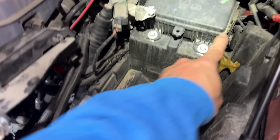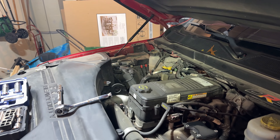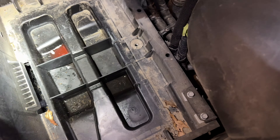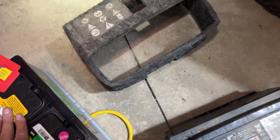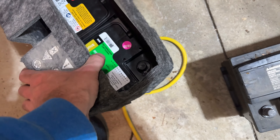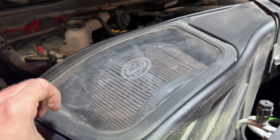It's designed to keep the battery from moving around while you're driving. I'm going to clean this up a little bit and then go to the other side — I am going to reuse the battery blanket. As you can see, this battery is now out. Looks like there is a little bit of coolant right here, probably from when I was filling something up or installing the Muzzy's AC hack. If you push the negative and positive out of the way and back, you can actually slide it forward once you remove that wedge, which makes it a whole lot easier to slide out.